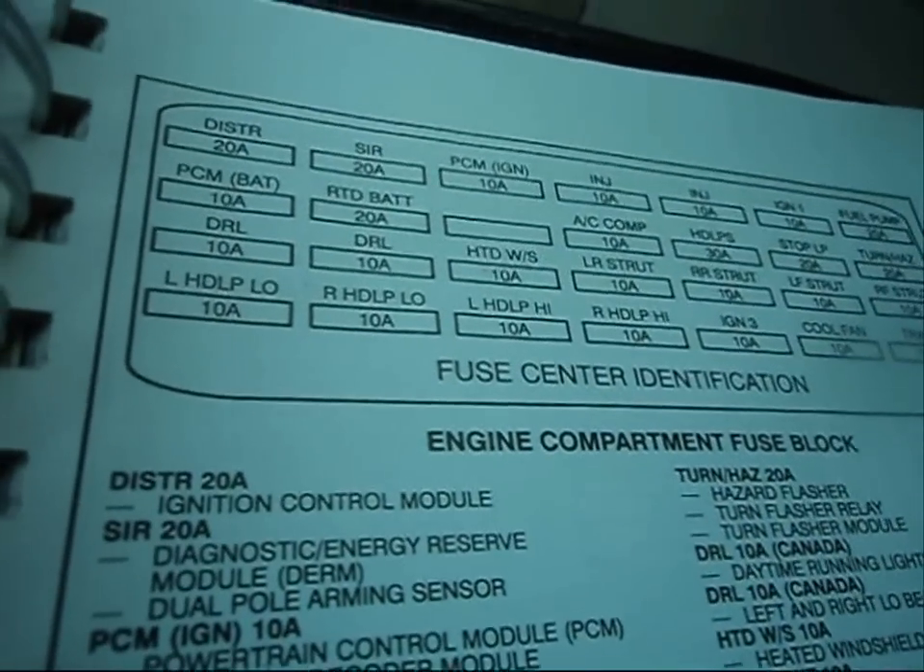This car is off the road anyway, so I'm going to go ahead and start ripping and tearing the dash. There are a few things you should do first before performing work on it. First thing, pull the fuse to the Supplemental Inflatable Restraint, or SIR, or airbag. Pull the fuse and wait at least five minutes. A lot of repair manuals recommend pulling the fuse — not just disconnecting the battery — as there may be a little bit of stored energy. We'll also need power to make sure this works properly.